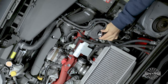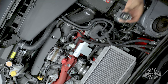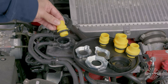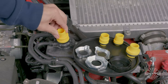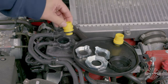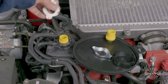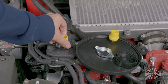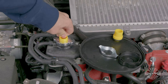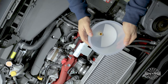Regardless of the kit you get, you will likely have to find the right cap. Remove your radiator cap and set it aside. Now find the fitting that fits perfectly in the opening — the goal is to have the fitting's rubber seal prevent any coolant from spilling out, so it has to sit on the lip inside the opening. If you did it right, the cap will be tight, and this is important: the engine vibrates a lot when heating up, so we don't want this to work itself loose. After that, securely fit the funnel onto the fitting you just placed on the coolant reservoir.